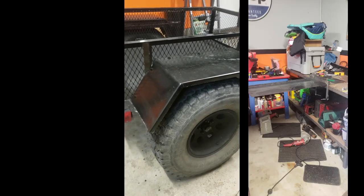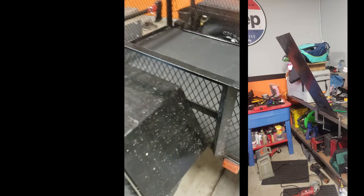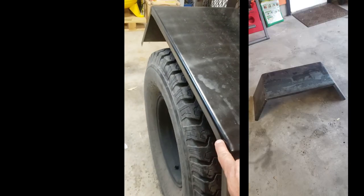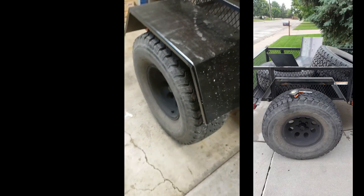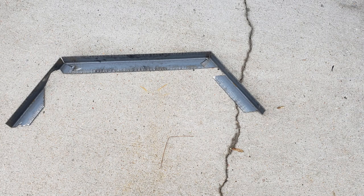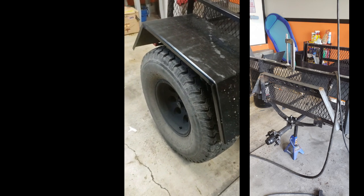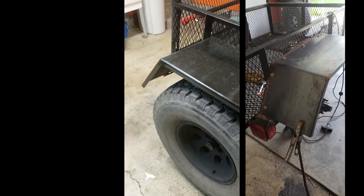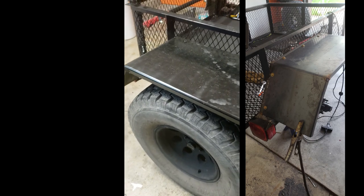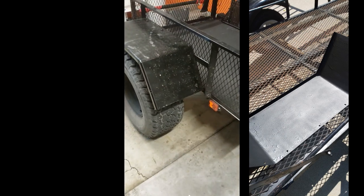The fenders are custom-built. A friend of a friend used 16-gauge steel and bent a lip in it for me. I notched them, put them on, clamped them down to the workbench and bent them over to get the angles I wanted. This keeps rocks from being thrown into the back window of the Jeep and keeps it legal going down a lot of the roads. I used rattle can bed liner — the rubbery stuff — just to protect it, and then inexpensive black spray paint to match the trailer.